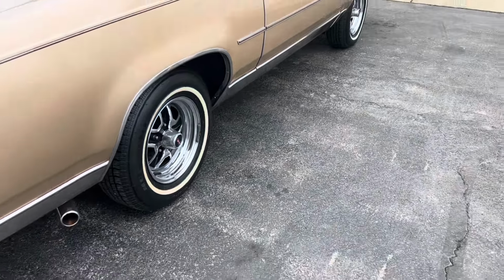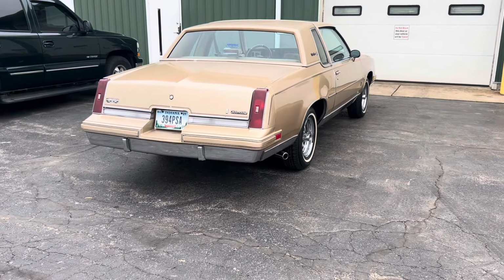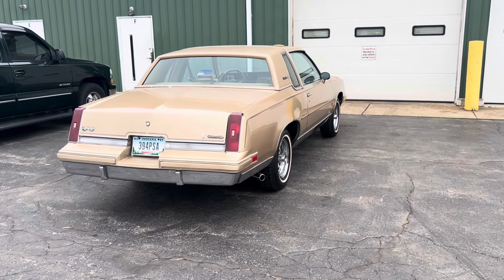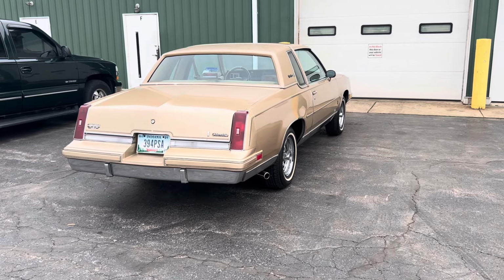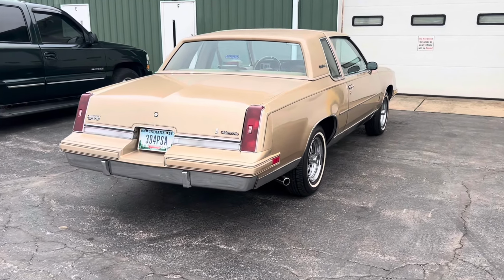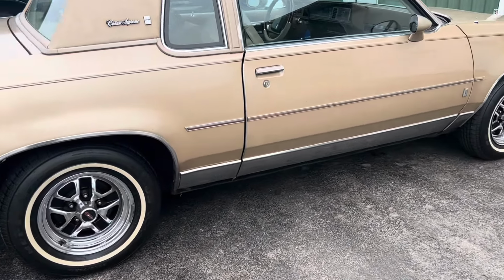It's gonna have a basic lip for right now. And when I do the 24s on there, even with the rim being by 10 on the rear, I just do the quarter rail frame notch in the back. As long as you have the anti-roll, the good control arms and all that, the rear end's not gonna move and shift all over the place, and the tires ain't gonna rub the wheel wells. So no mini tub is needed with 24s on a G-body when I do it.